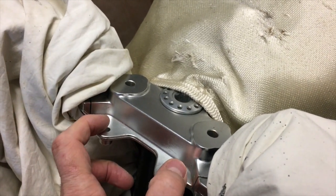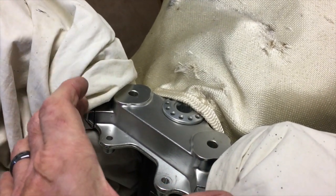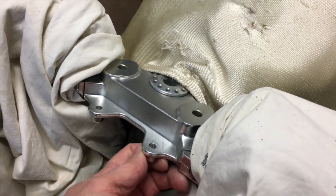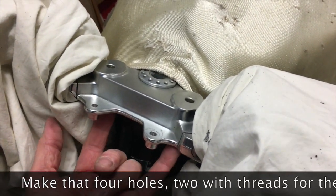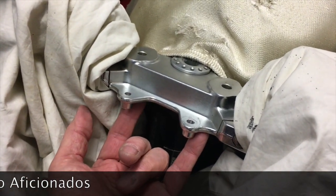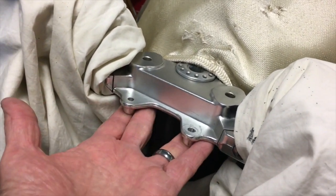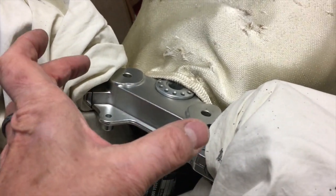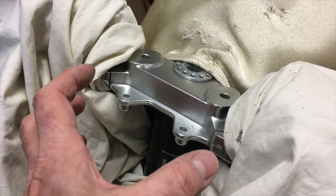This bracket here used to support the rubber bungs and then the clocks on top, but they stick up really high which I don't like. So I'm going to drop them right down underneath. They've got lugs on the bottom here which I thought about removing, but there are actually four drilled and tapped holes underneath which were for various screen and fairing options. So what I'm going to do is remove this whole piece along here and put a flat plate to mount the clocks on, squeezing them in as close as I dare.